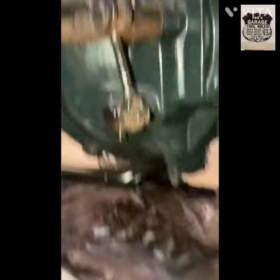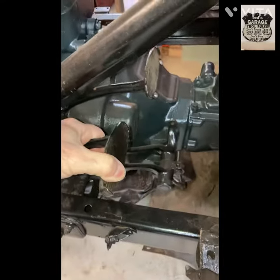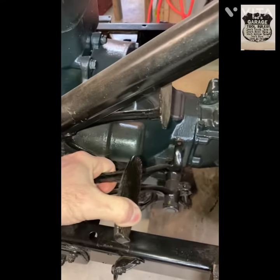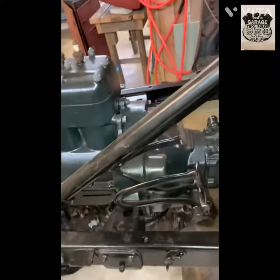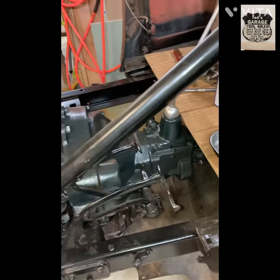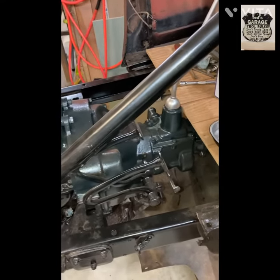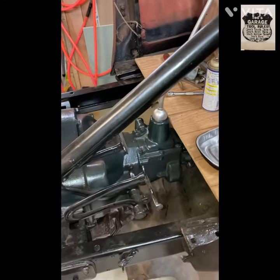Test it — the adjustment is supposed to be about one inch before it starts disengaging the flywheel. It's going to be hard to judge that until you put the pin back in and have the engine running and test it. You'll probably have to do it again, but like I said, it's five minutes with a pair of pliers and maybe a screwdriver.